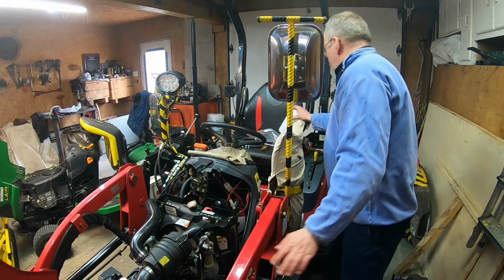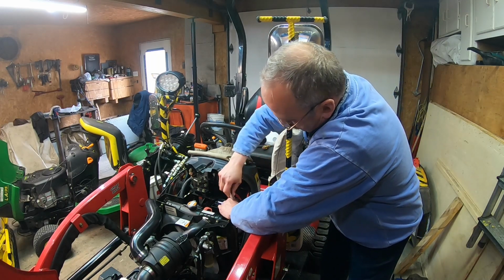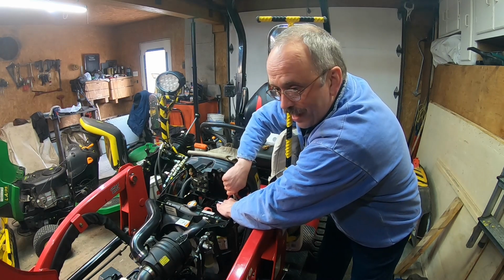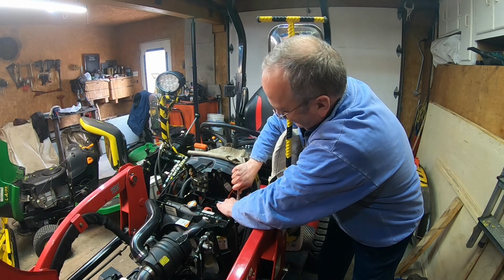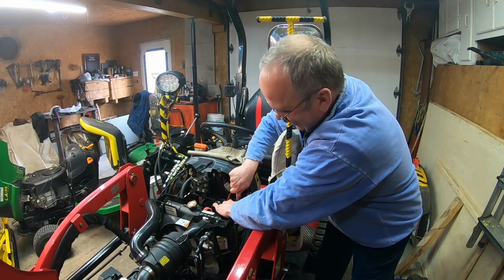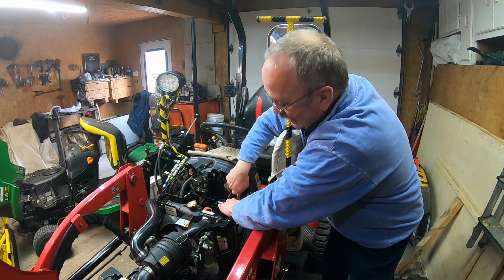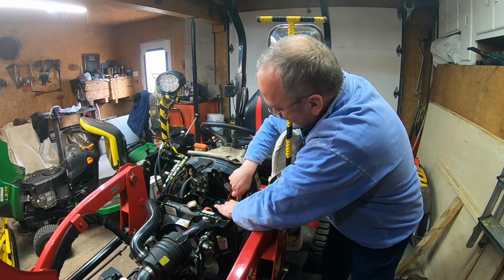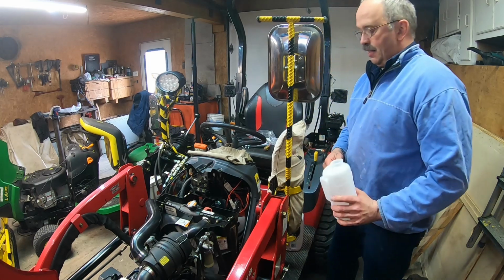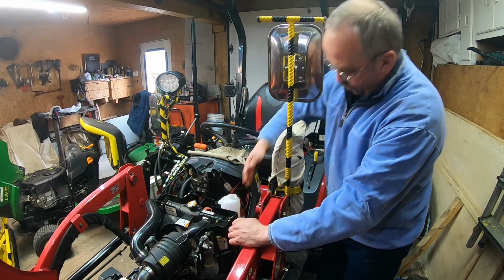So at this time, now that I know it's fitting very well, what I'm going to do is simply torque the bolt with my personal torque wrench. I'll go with 100 inch-pounds. All right, a little bit more. All right. Now I'm gonna put the reservoir right there.